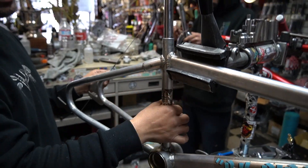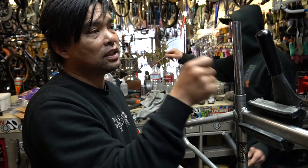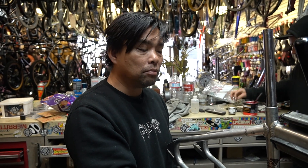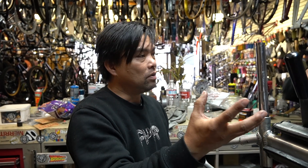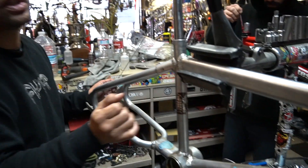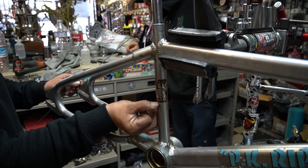So that tells me something is going on right here. This is an aluminum frame with a steel seat post. The steel is not gonna rust together with the aluminum, but with a bunch of gunk and aluminum buildup — sediment and all that — it gets all crusted and fuses together. We have to break it open, but it being right here is a very good sign.